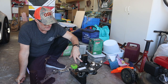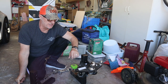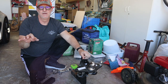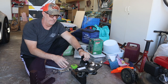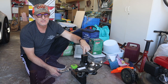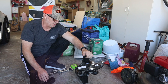I thought no big deal — I'll just flip the shank around and mount it as a rise. To make sure we were okay on capacity with it in the rise position, I looked it up, and it said to be used in the low position only. Normally they'll list the part number and say you can use it as a six-inch rise or a four-and-a-half inch drop, but this one said only use in the drop position. Initially I thought it was no big deal — it's solid two-inch square steel, heavily gusseted, massively huge welds — but I'm not going to use something that says we can't use it in the rise position.